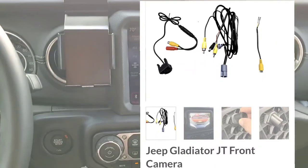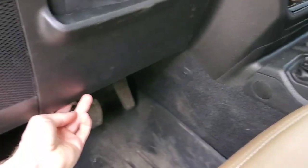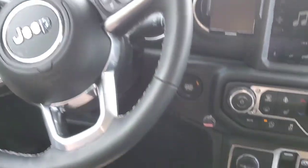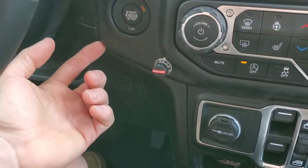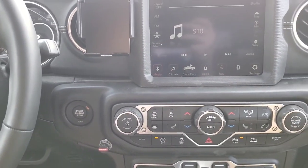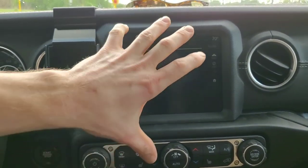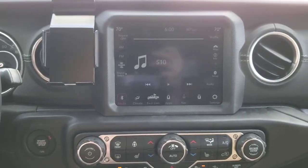To give you a quick idea of what the install takes — it's relatively easy. You start by pulling this trim panel out right here; you can grab underneath and pull and it just pops out. That's mostly just to route your wires. Then you stick your finger or a tool once that panel is out and pull back this strip — that whole piece pops out. Then there are a couple screws back here holding the bezel, and once you pull those out the bezel comes off. Then there are four screws for the screen and the whole screen will pop out.